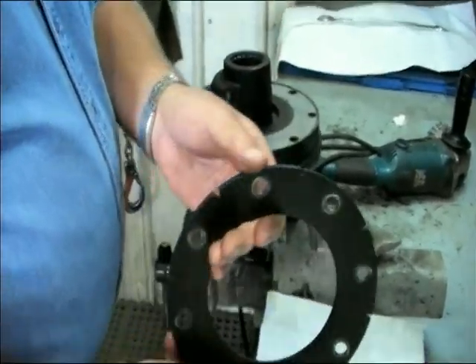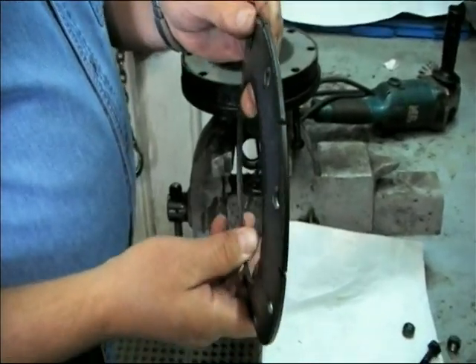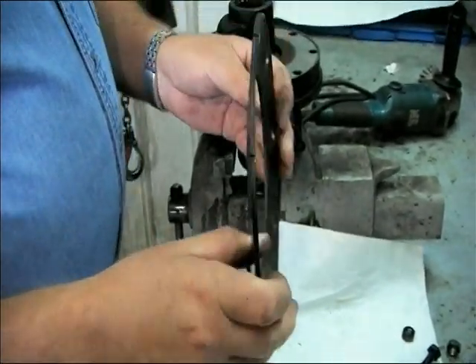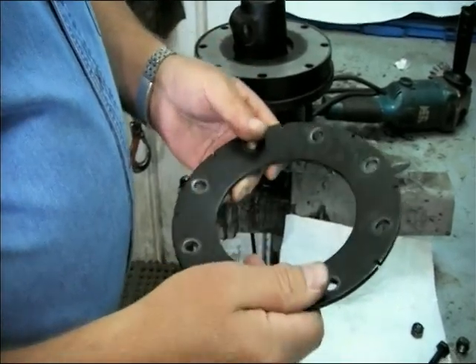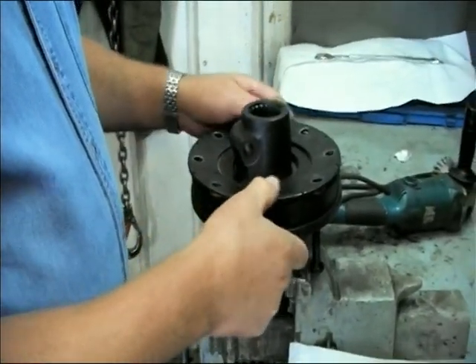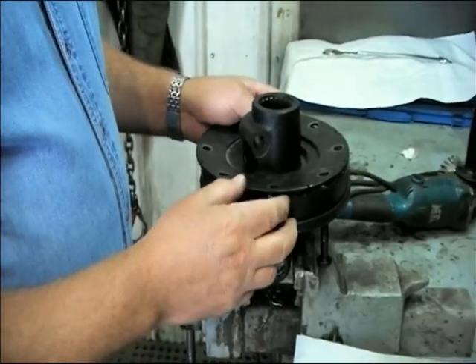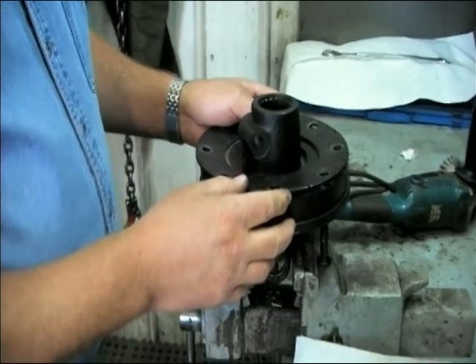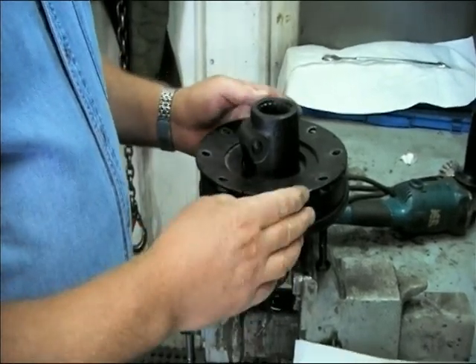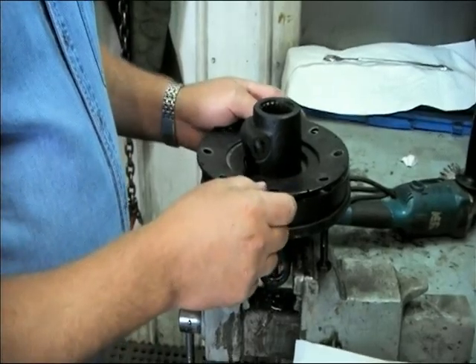This is the spring plate. You can see clearly it's a very beveled plate. The intent of this is to ensure that when the spring is compressed, the linings can wear down to 2.5 millimeters and the torque on the clutch will still remain the same during that wear period.